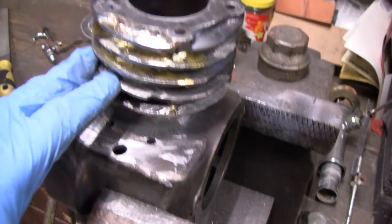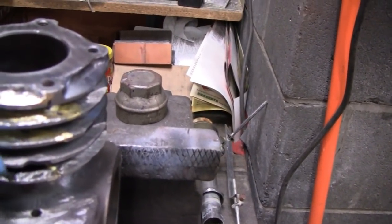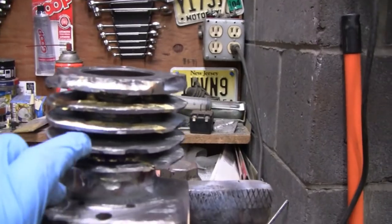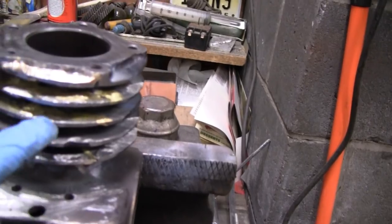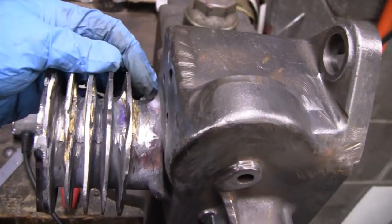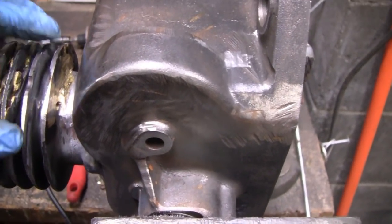I got the tops of them all pretty much flat and they all came out much better than I expected. It's only the edges that people are going to see — they're not gonna look inside there, so it doesn't matter how fat it gets inside. You just want the fins on the outside to pretty much look uniform. It may look like hell on camera but it looks good right here. Took off quite a bit — got brass all over me. I'm going to turn it over and just thin them up a little bit more. I got the bottom of the fins and I'm real happy with this — there's hardly gonna be any epoxy on this at all.